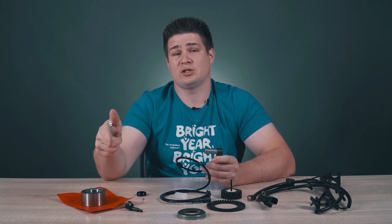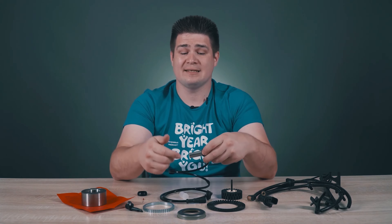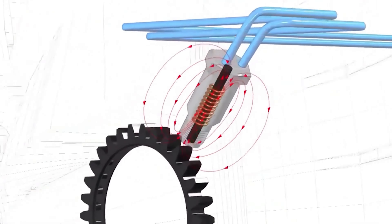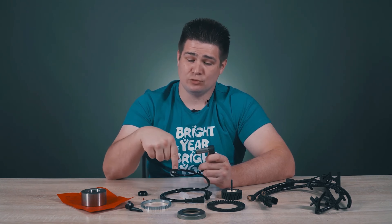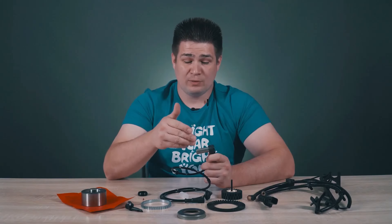From basic physics, an electric current and a magnetic field affect each other — if something moves in the system, an electric current occurs. So inside the passive ABS sensor there is a magnet, we move an electrical conductor around it, and an electric current appears in the coil as a signal. No power is supplied to the sensor; it generates a signal by itself. However, this is its big disadvantage, since the signal is very weak and not very resistant to external interference or geometry violations in the gap. The second problem is that this sensor does not start working from zero speed.